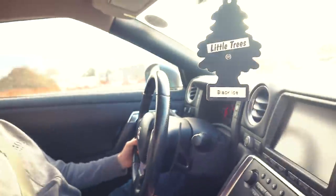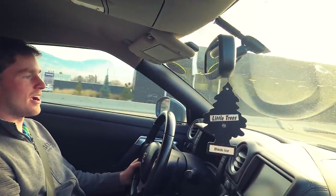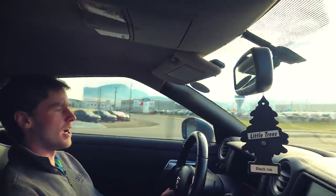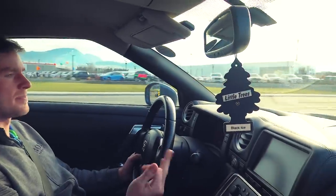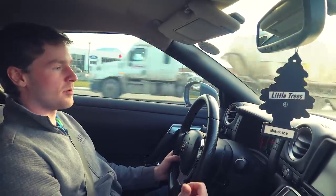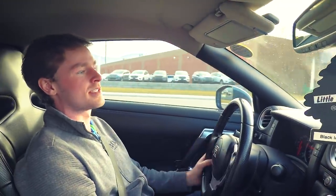Okay, Max, tell me about your GTR. All right, so it's a 2010 Canadian car. This year, we recently had full bolt-ons. So we've got injectors, fuel pumps, downpipes, exhaust, intakes, a couple other little things, too. And Vex Performance's dyno, which is the heartbreak dyno, so it's a true wheel horsepower number, no lies. It was 509 rear-wheel and 560 all-wheel, which is quite a bit of power on that dyno. Similar Alpha 9 GTRs are making around 550 to 600.